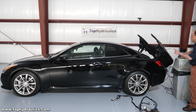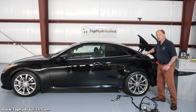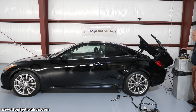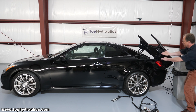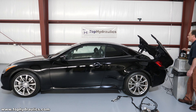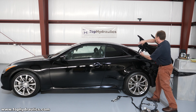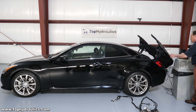Before we retract the top, don't forget the parcel shelf. If we were to pull the top back now, it would pull down on the rear end of the parcel shelf. So we lower the parcel shelf first, electrically all the way, and then we rotate it up — that is the second motor on the parcel shelf that rotates it up. The parcel shelf needs to be down at first when you retract the top. Then, when the top comes to the highest position, we raise the shelf halfway so that when the top comes in all the way it doesn't collide with the bottom of the parcel shelf. We have the parcel shelf all the way down and flipped up.